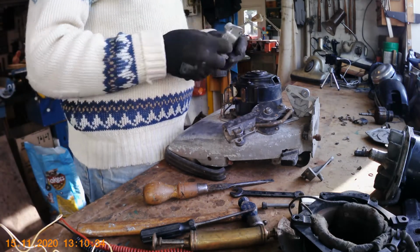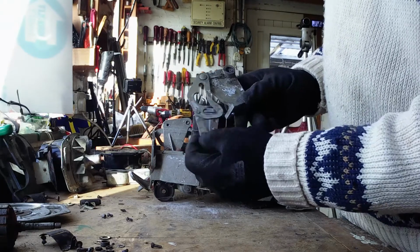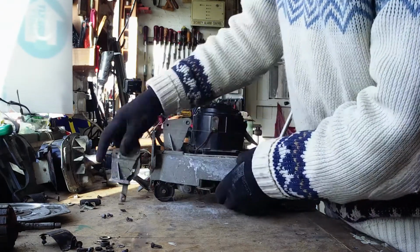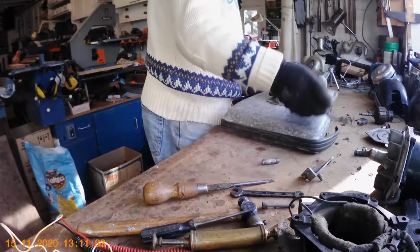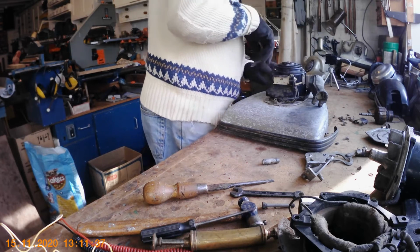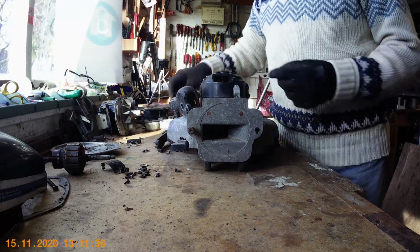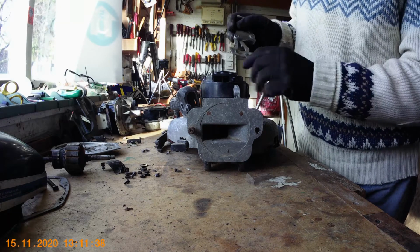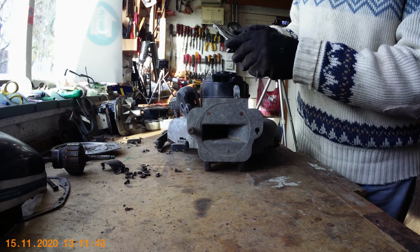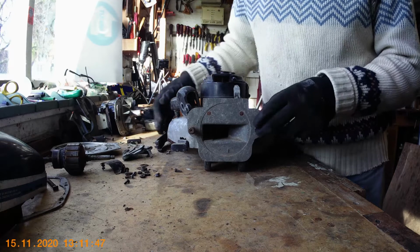If you want to see what they look like, this is what it looks like. And it's got a linkage. What happens is this fits on like so, and the linkage goes underneath the machine and is linked to this lever here to lower the handle. But you can undo the screws, but to take that completely off, you have to take a little pin out in here, and it's a bit of a fiddle, so my advice is leave that on there unless it's broken. These are very prone to breaking. We had loads of these broke, so be careful you don't break it, otherwise you'll be stuck.